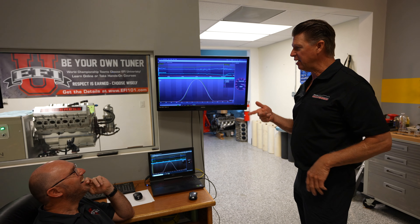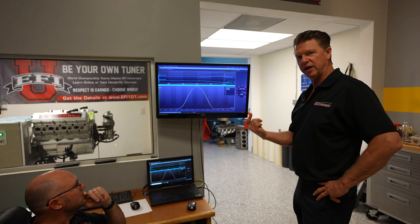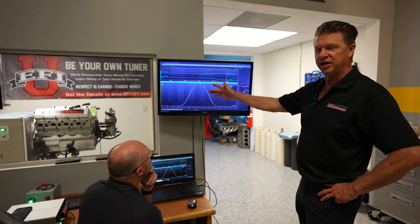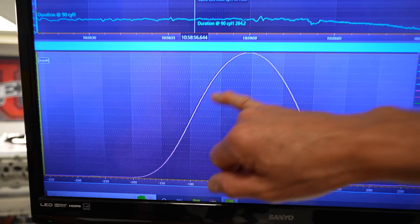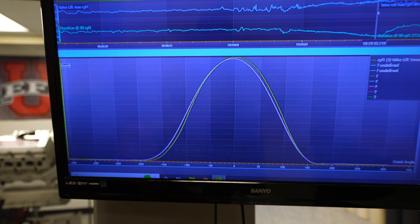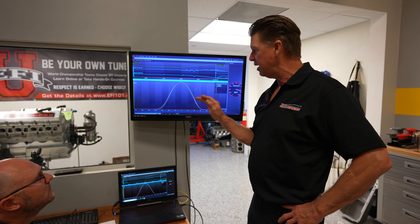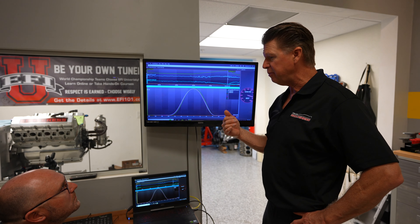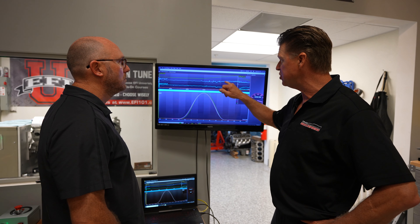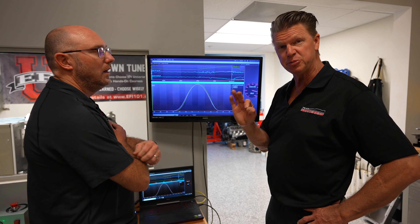We're looking at the Sorcerer's engine here. We just ran another test run and have the laser beam looking at the exhaust valve — essentially inside the engine, looking at the bottom of the exhaust valve. Ben can measure it within a thousandths of an inch with a sophisticated software program that plots it out. If you look at the purple, that's the way the camshaft was designed — that's the original lobe design. Ben's going to overlay the yellow, which is actually happening in the engine. The ideal is if we can get our valve train overlay to follow the purple as intended by the camshaft design. What we've done by lowering the spring pressure and choosing a different style of spring has smoothed everything out, and Ben's going to explain why. This is a really big development for us, and it was because of the spring change.